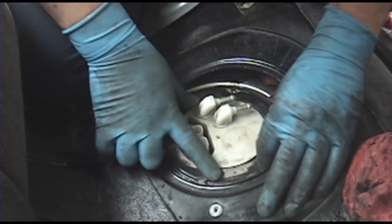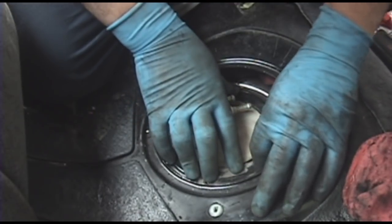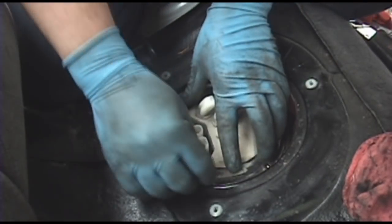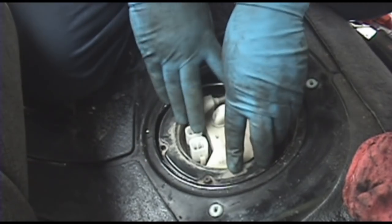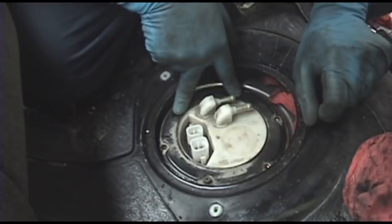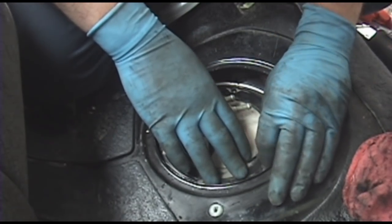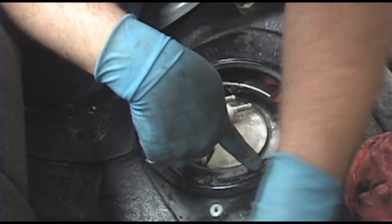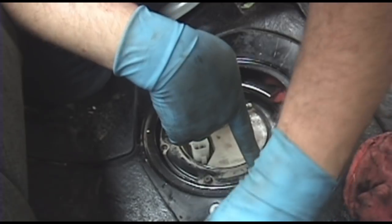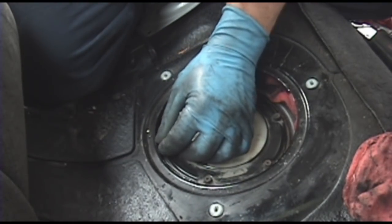and these just snug, not even snug, just, if you look at them wrong, they'll strip out. They're seriously that sensitive. 4mm threads don't take much torque. They can't take much torque because they're so damn tiny. I'll look at the actual torque spec, but also if you lose one of these, oh crap. It's on the magnet, thank God.